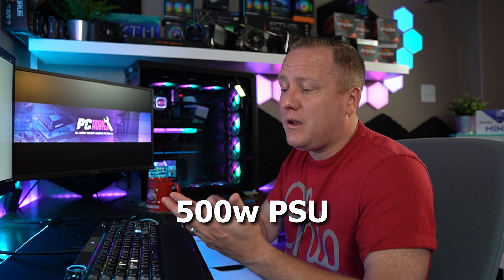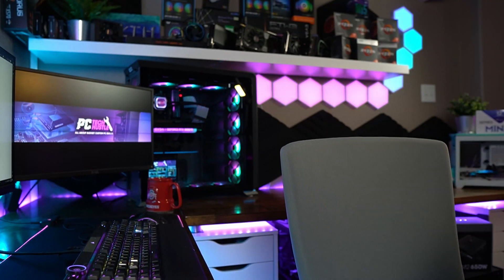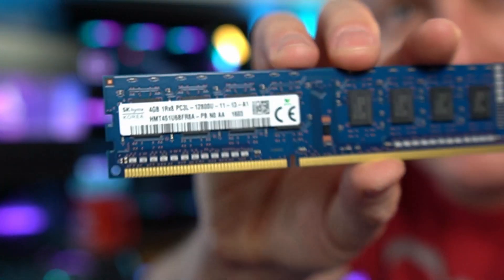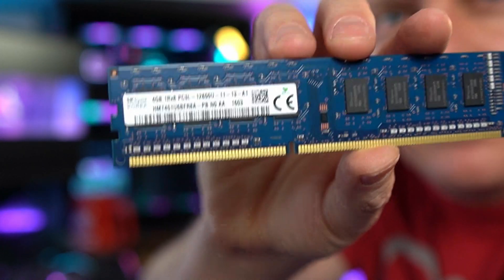All we've got to do now is find a power supply that'll accommodate this card — pretty much all we need is about a 500-watt power supply of good standing — and then we're going to need a power supply adapter so that we can adapt an 8-pin to the motherboard, as well as some more RAM. I'm going to pull one of the sticks out here and see what we've got so we can just match it all up. All right, so here we've got the DIMM and it's a 4GB SK Hynix PC3-12800.